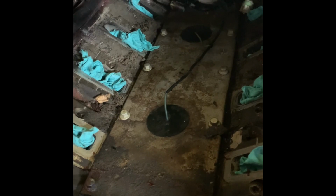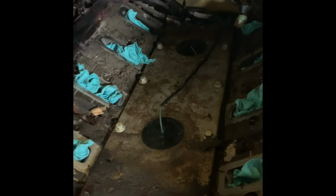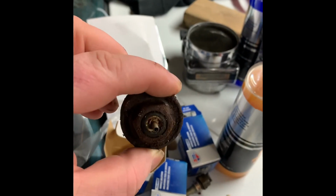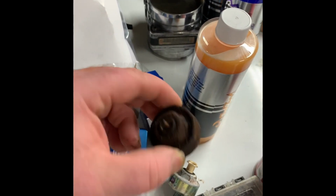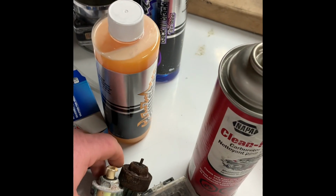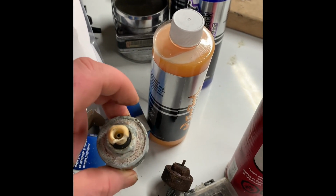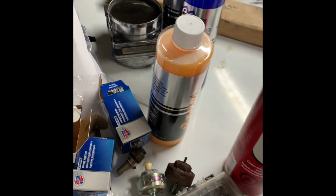And yeah, so we got two new NOx sensors in there, and I can tell you right now, the NOx sensors were damaged because, well, I like doing car shows and I wash the motor a lot, and there was water that got in there, and of course corrosion happens. So here's our old NOx sensor. Poor guy. That's one of them. He's not doing so good. He was the front one, and then of course this is the back one. Not so far along corroded wise, but corroded, finished. Time to change them, so we did.